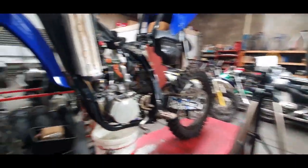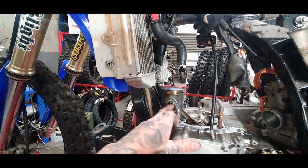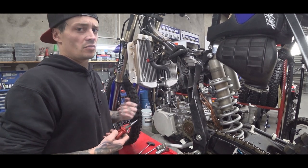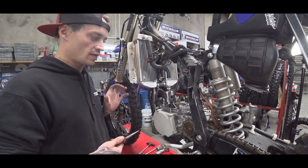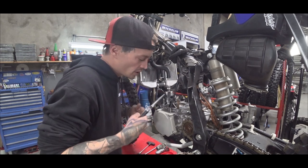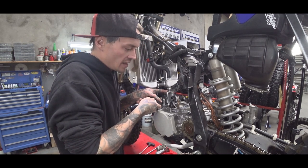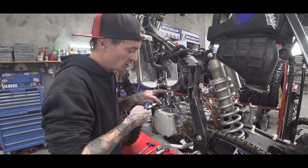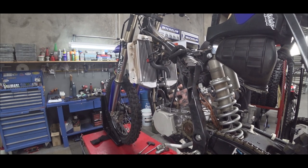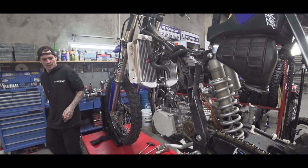Now over at the bike it's time to get the piston out and off the conrod — gudgeon pin out, circlips, little end bearing. You set a pointy nose pliers in there to grab the circlip out so the gudgeon pin will slide. You can just do one side to get the gudgeon pin out and get everything off the motor to the bench. You've got to be semi careful pulling these out — it's not really something you reuse, but it's a part that can easily go over the other side of the shed and you'll never find it again.